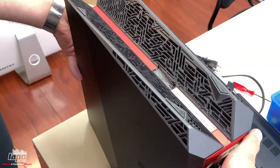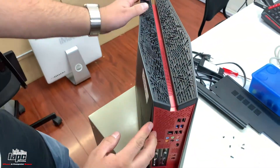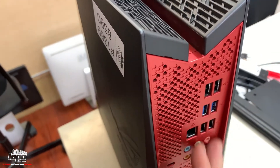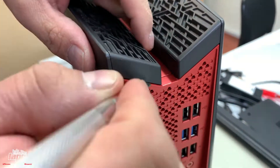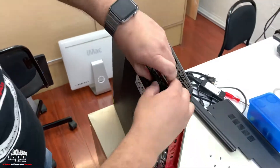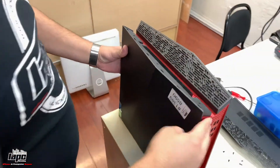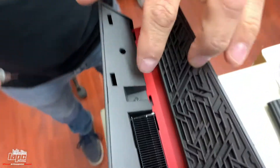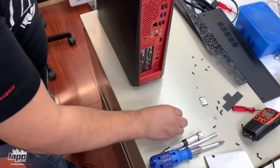Put it on the side. Then you have another little area — you see this little gap over here by the USBs? You're gonna get a little spatula and lift it; it has some clips so don't worry, just pick it up. In here you're gonna have one more screw in this area. We're gonna remove that screw — same size, no worries about that.